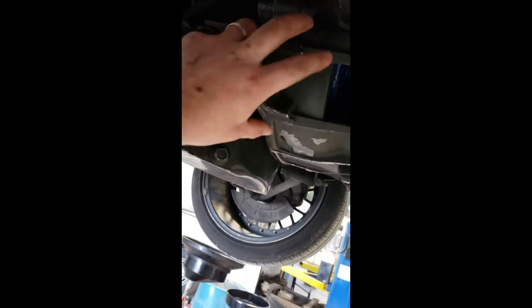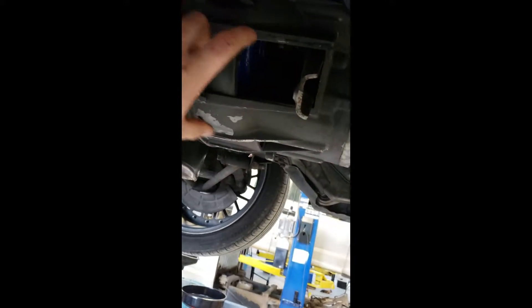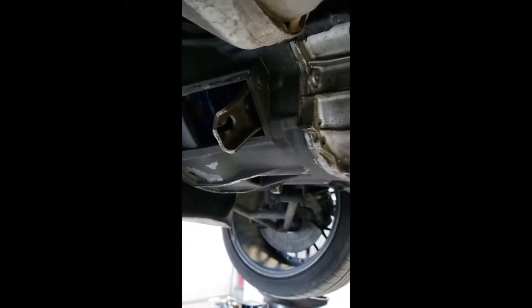Starter's off. Clutch cable is off right here. A couple things I forgot to mention: there will be a dust shield plate that goes right here and bolts there with an 8 millimeter — you're probably still going to have that on there. Mine is off because I was doing some inspecting trying to figure out why the clutch slipped. Another thing: I have a tubular K-member. If you do not have a tubular K-member, some of these things will be a little bit harder to get to, like the starter, but still doable.